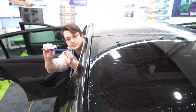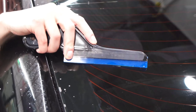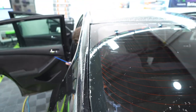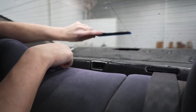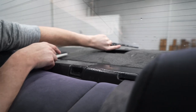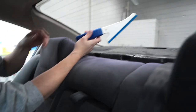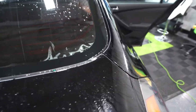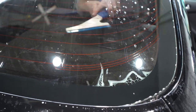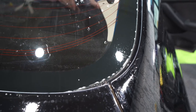You're getting this blade to conform to the glass so when you put pressure on it, you can see that bend, and then you swipe it right along the inside of the window. When squeegeeing out at the bottom, I put my hand on the handle as close as I can to thin it out so I can get pretty far down. If you need a bigger handle, check out the stroke doctor — a little extra handle — so you can swipe all that out.